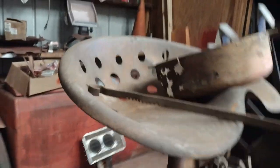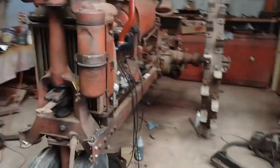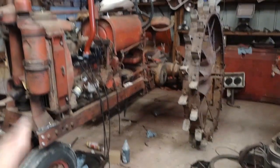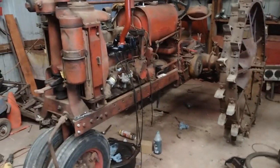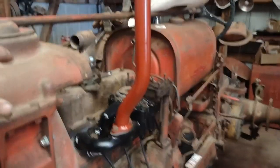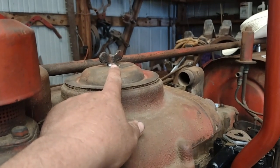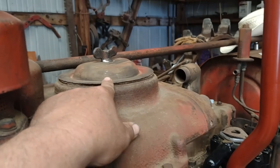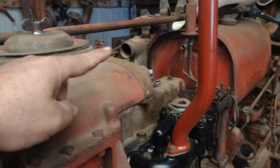This cover here is the air-cooled function they had for the 1938 F12 — that one goes on that side, the other goes on the right side of the tractor. I've got my exhaust pipe on, had to re-thread a screw, got the gasket made for that, and it's ready. Antifreeze is in, carburetor is ready to be installed, and all the lines have been cleaned out.